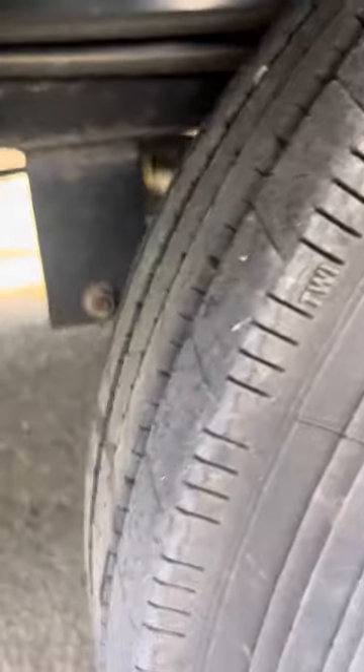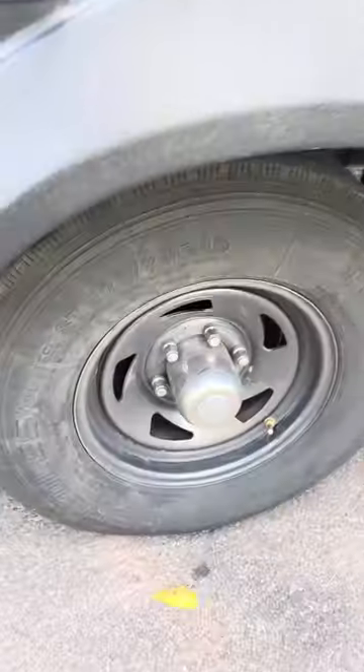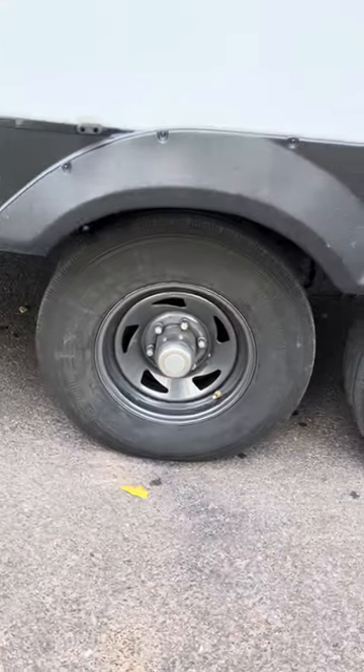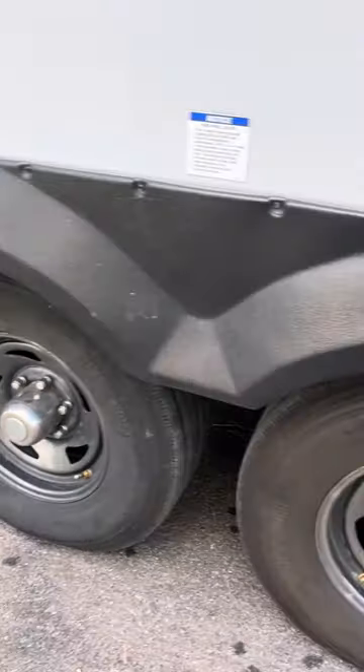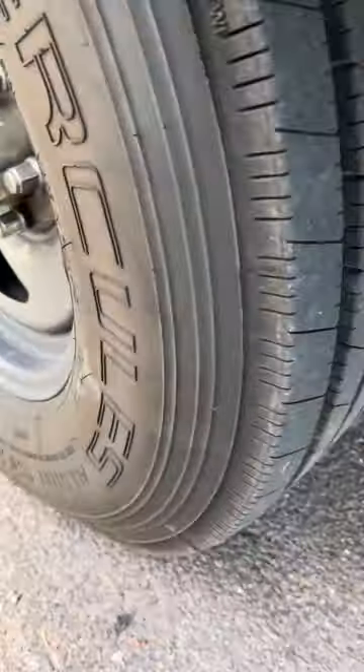It's starting to make itself evident. But if you didn't check the temperatures, you might not catch just that difference in tread depth across the tire. So my guess is this tire is going to fail. These are $230 tires. Now I'm in an awkward position of — do I replace it, or do I just wait for it to fail?